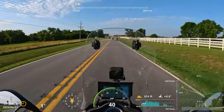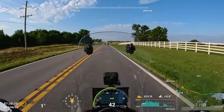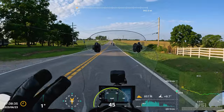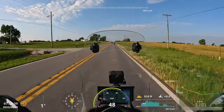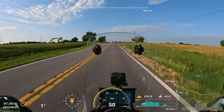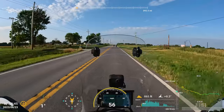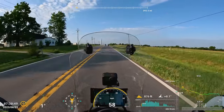So the torque drive was the problem all along. Now, whether it affected the Dr. Pulley variator's longevity and reliability, or if it was the other way around, we don't know, but definitely the torque drive was shot and the Dr. Pulley wallowed itself out and it killed the center bush on the drive portion of things up front.